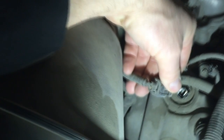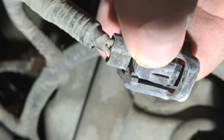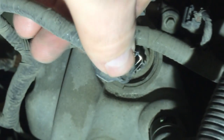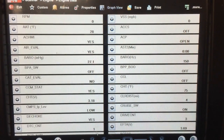Go to the affected cylinder bank that's exhibiting a misfire problem, and tap into the ground wire briefly. On the passenger side it's a violet and light blue wire. On the driver's side it's a dark green and orange wire. If you tap in a ground to either solenoid and it resolves the concern, the solenoid was stuck open either because of debris stuck in the solenoid passages or because the solenoid itself had failed.